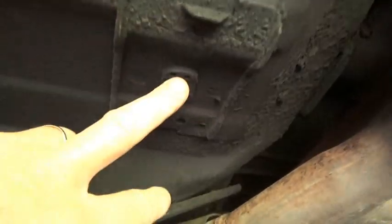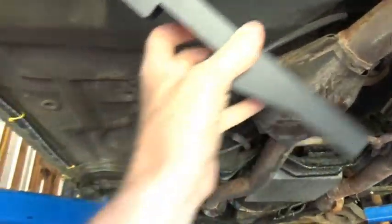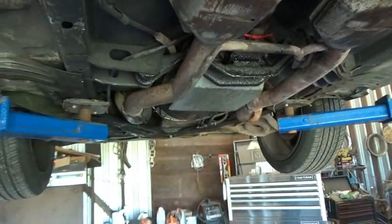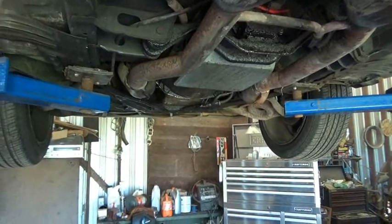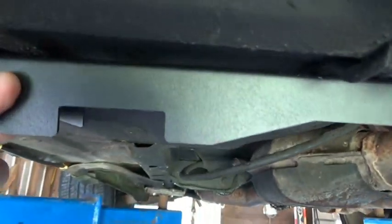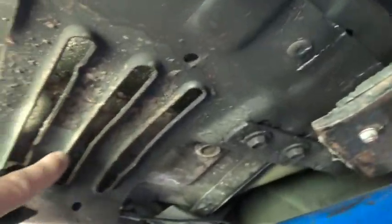My set was a cheaper set, but here's what they look like. You've got a bar here, and here are your seat bolt holes — one there, one there. This bar kicks up and since it's angled, one side is actually longer than the other. When you flip it and put it in, you want your longer side there. That's what holds it from flexing. The bar runs right through there, hooks to the frame, then kicks around to the back. The front end also comes with these pieces on the convertibles, one on each corner near your wheels.